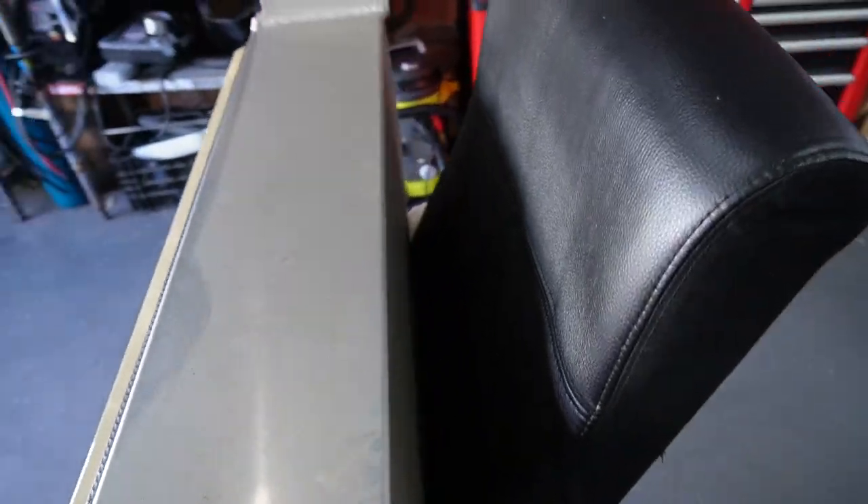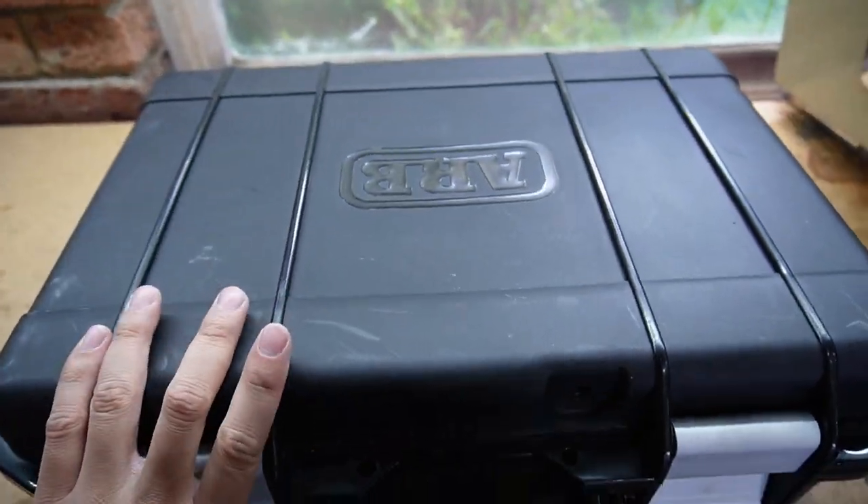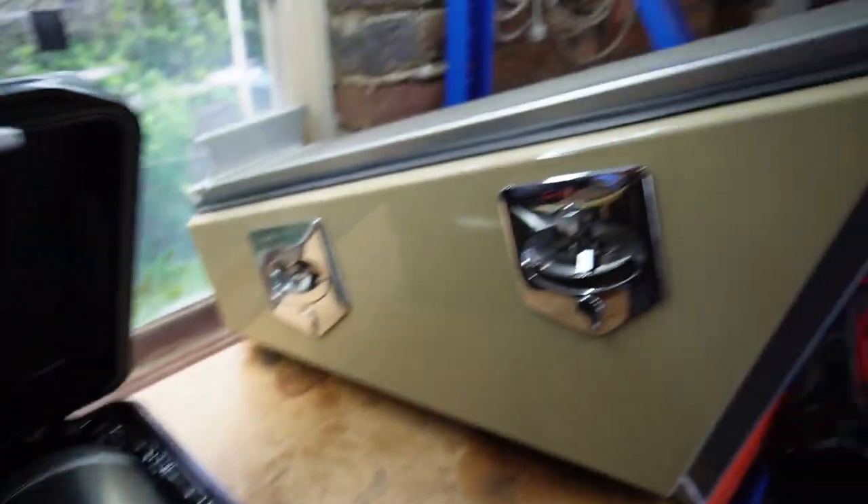We're going to be mounting the compressor inside this toolbox with the air tank directly behind it. Personally, I don't believe in putting air compressors inside vehicles unless you absolutely have to — especially in a ute you have plenty of other options. They build heat, create condensation, and they're really noisy. The engine bay is another option but it's also a harsh environment. In my opinion, for a ute, the best location is inside the canopy or in a sealed toolbox. First thing we're going to do is disassemble this kit to work out how to mount it.